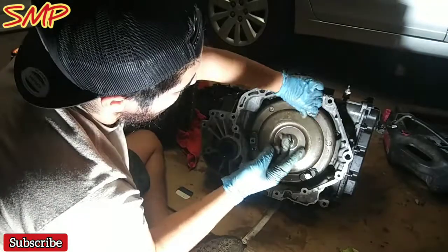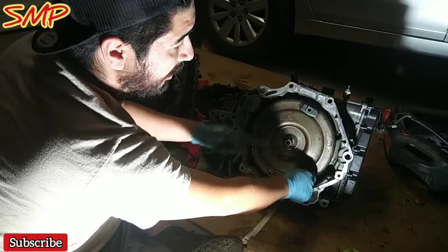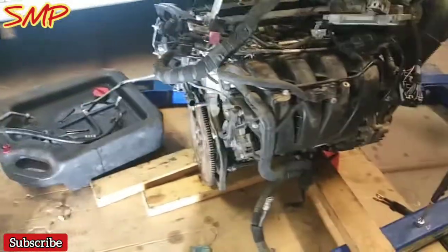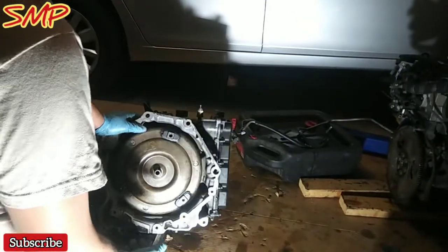Just a really quick reminder. These are the torque converter bolts. I just put them back on here. I pretty much took them off of this one, put them onto this one just to check. Obviously before you mount it onto your flywheel, torque converter bolts will shoot from the block towards the transmission. That way you can hold on to your torque converter. But definitely remove these, move them out of the way. I'm going to go ahead and start installing this. So we'll be right back.